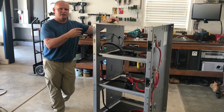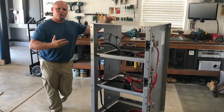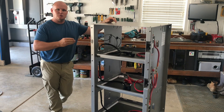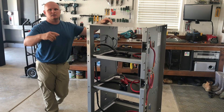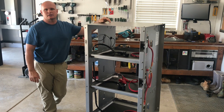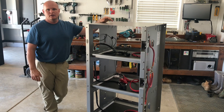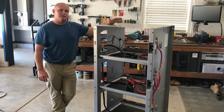I don't want to parallel these batteries from positive to negative to each battery. The guidelines for these batteries say a single cable run from each battery to the point of connection. They do not recommend paralleling from positive to positive to positive to negative to negative, like we do with a dual lead acid battery. All recommendations say to run individual cables of equal length and connect them at a combine point.